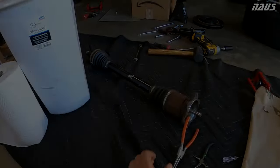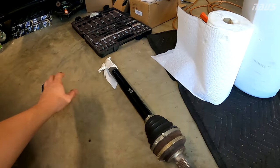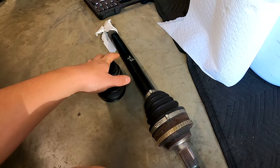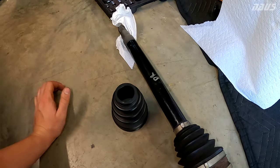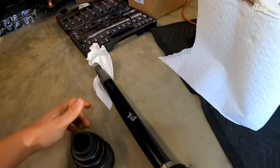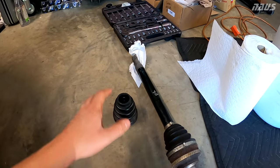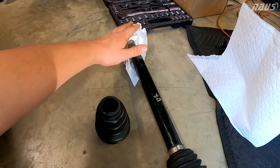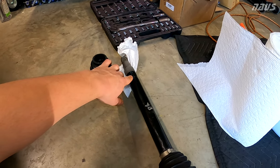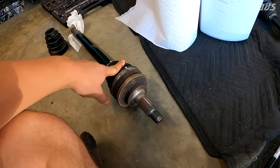S2000 axles — OEM axles, swapping the cups from side to side. I started without filming on the driver's side, got it all apart, but this is the proper way to do it if you're going to re-grease these. You want to take the boot all the way off, and the only way to do that is to get everything off the spline shaft — the side that goes to the differential. This video is just about the inner CVs, which are the ones known to cause problems. The outer ones do not have this problem.